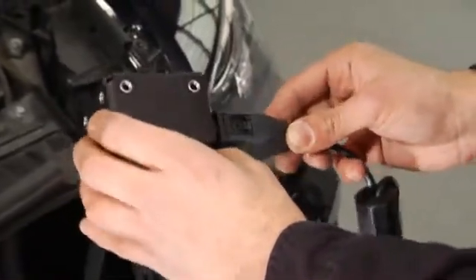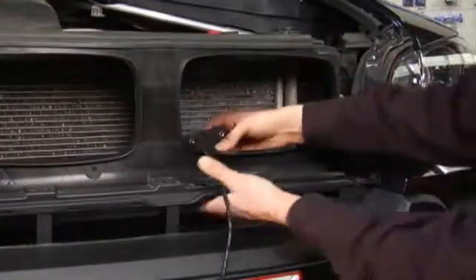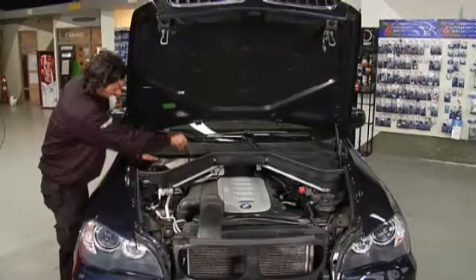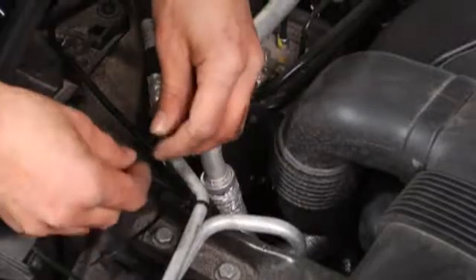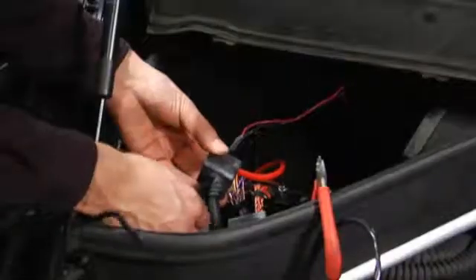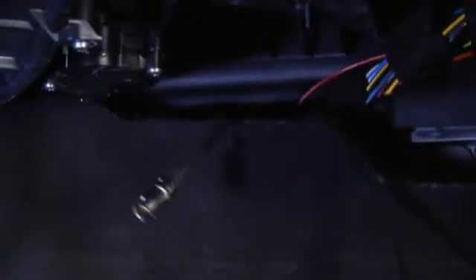Connect the Pathfinder to the pigtail cable. On the other end, the pigtail cable has a power in and a video out connection. Install the bracket — no need to adjust the height yet, as fine tuning will be done after the installation. The pigtail cable is routed under the hood and guided into the passenger compartment through an existing opening — no need to drill extra holes. The power and video cables are now inside the glove compartment, and everything under the hood can be put back in place.